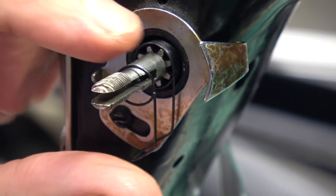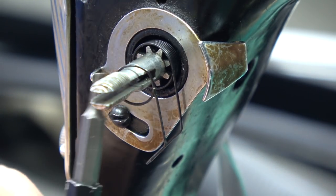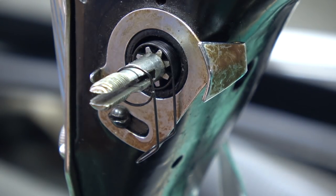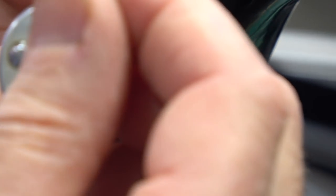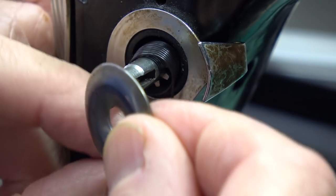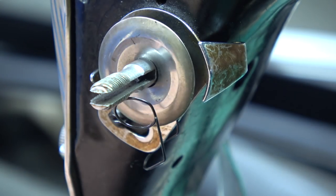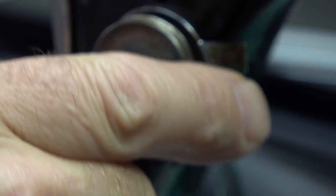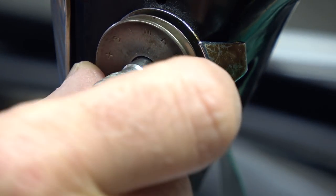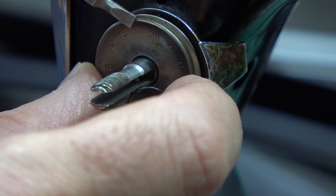Tease it back in — it just slides in — and you'll see I've got the springy arm at six o'clock, so it's pointing downwards. Reassembly is just the reverse. Make sure your tension discs are nice and clean. You'll need to carefully lift that arm out without bending the spring. Make sure with your tension discs that you get them the right way — you want a gap between the two discs when you put them on. If you had them the other way around there wouldn't be a gap and you wouldn't be able to get your thread in.